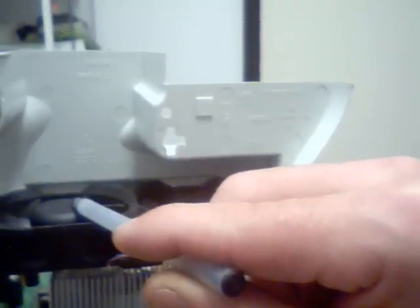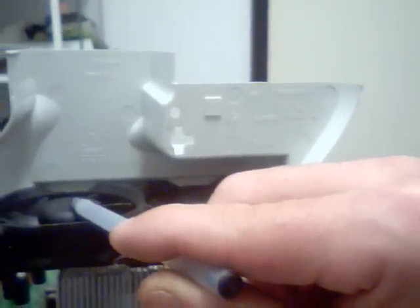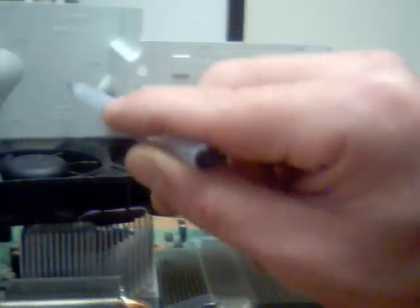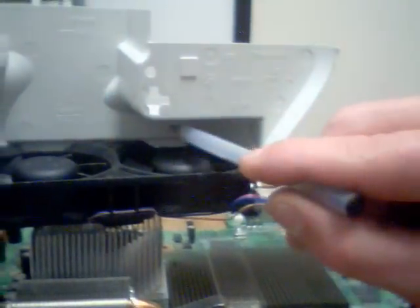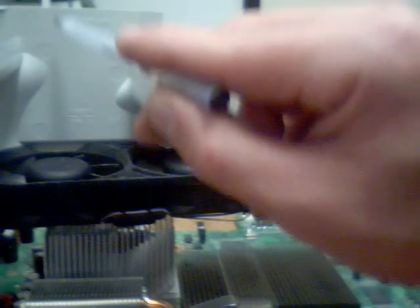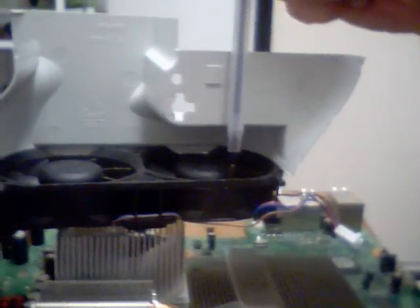See this right here? You got this fan here for the CPU, and this fan here for the GPU. But look — this is all open. That means that this fan and this fan are going to pull the vast majority of the air through the path of least resistance, the largest heat sink, and very little air is going to go through this half inch portion here.